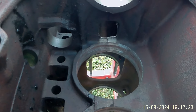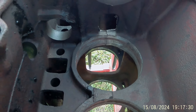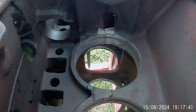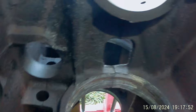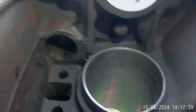Anybody that's ever built any high performance engines knows there's a thing you do with stock rods and blocks. Anywhere there's a parting line in the casting or forging, you grind it down and polish it. Because if you don't, it creates what are called stress risers, and stress risers lead to stress cracks. Now look carefully right here — see that parting line? They are cracking at the parting lines of the casting from stress. It is stress cracks.